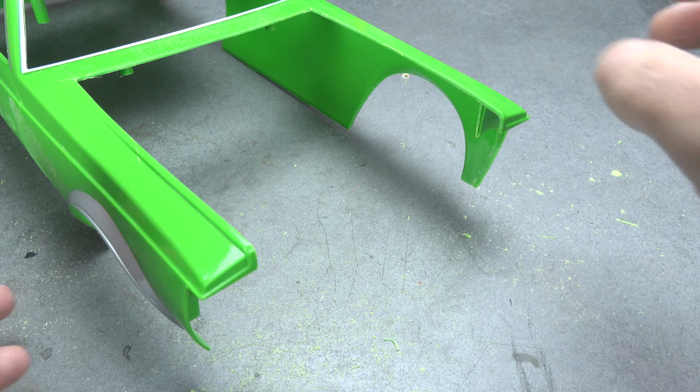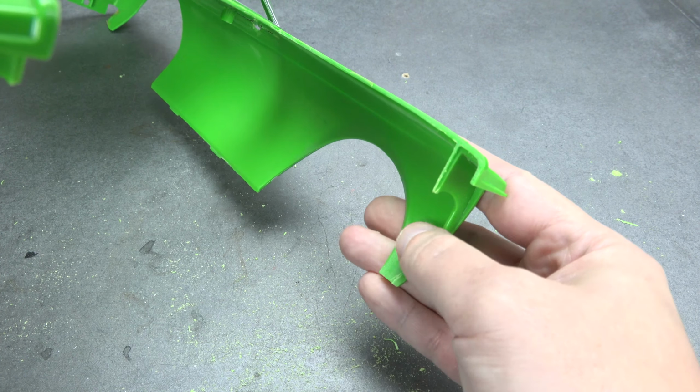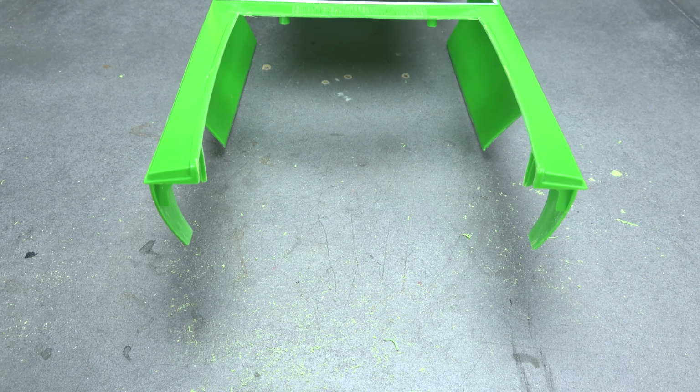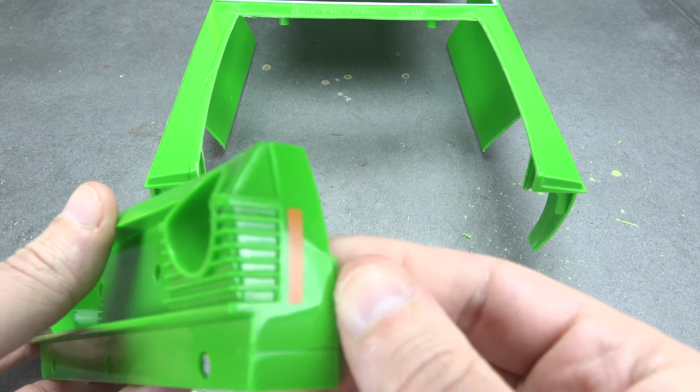Welcome back, guys. Before the commercial break, while I was cutting the hood, I had removed the front grille and light assembly. Well, we're going to need to reinstall that to ensure that everything's square when we fit the hood. I'll use the factory glue points to remount the grille, and I made sure to clean all the old glue and sand it nice and smooth. I want the new bond to be better than the original.